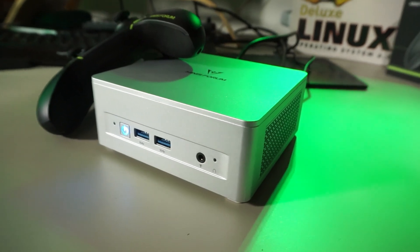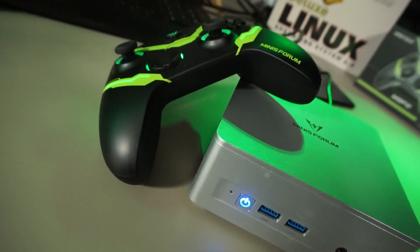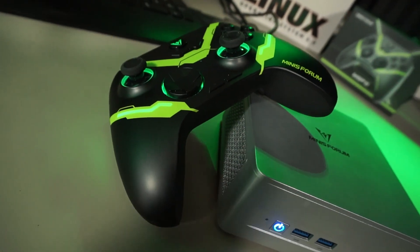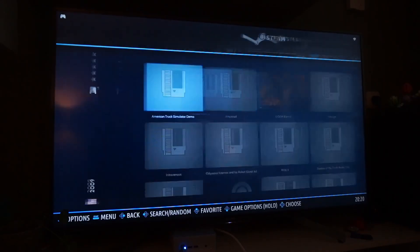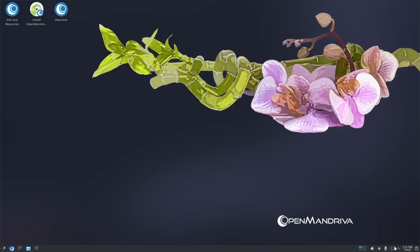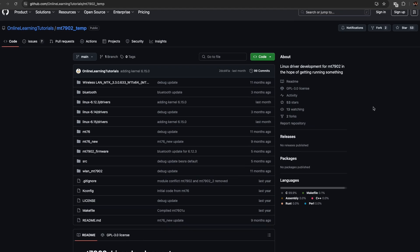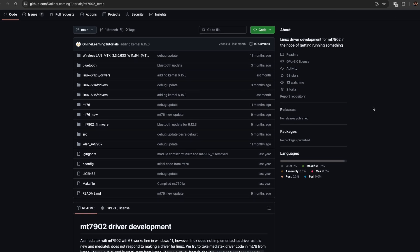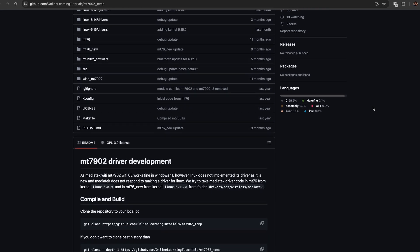What about using this UM750L Slim as a dedicated living room gaming and media PC? The Linux results I showed were already on Batocera, so we're halfway there. However, the WiFi and Bluetooth adapter did not work on Batocera. I booted up OpenMandriva and confirmed — nothing. The card identifies as MediaTek 7902, which doesn't seem to have Linux support. There is a community driver on GitHub, but building a module for Batocera means building the whole of Batocera.